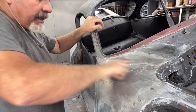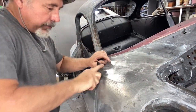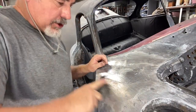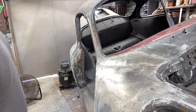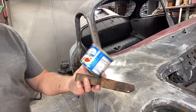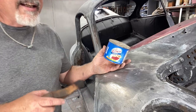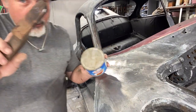Compared to soldering copper pipe — you wonder why you have a leak when you've soldered dirty — even a little bit of dirt and the solder won't stick. So what I also do: I use Crisco, believe it or not. You could use tallow — that's the proper way. People use candle wax. But someone told me Crisco a long time ago and he used Crisco. When you're done with it you can lick the spoon — oh, don't do that, I'm just kidding.